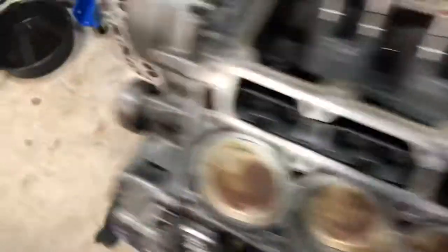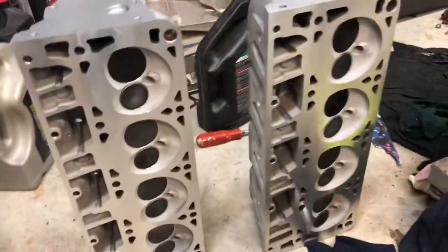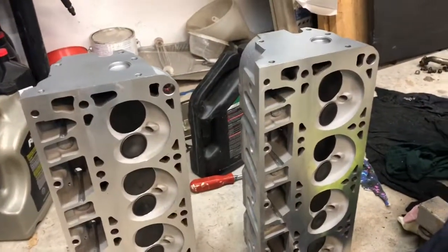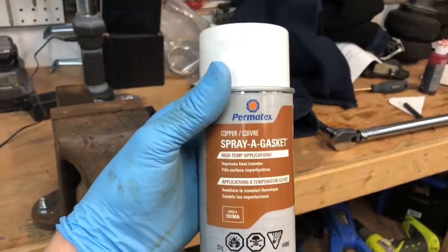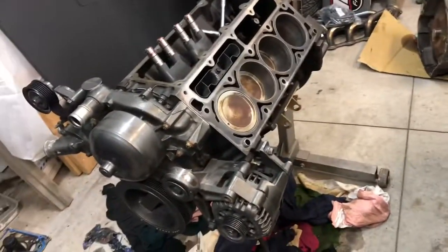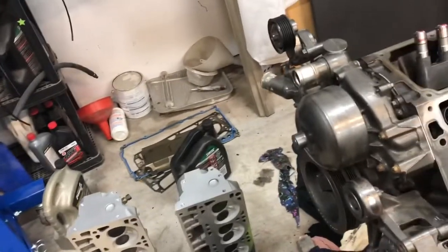So I'm just going to throw the heads on today. I got the head back from the machine shop — had some new intake valves put in them, cause they like to distort. So I'm going to get those thrown on today. I've got my LS9 head gaskets hanging here — I sprayed them with this copper spray gasket stuff. That's what the engine builder told me to spray them with. I guess it helps them adhere better, and we're putting some boost to this thing, so we want it to stay together the best possible.